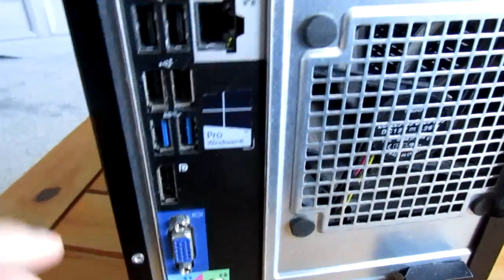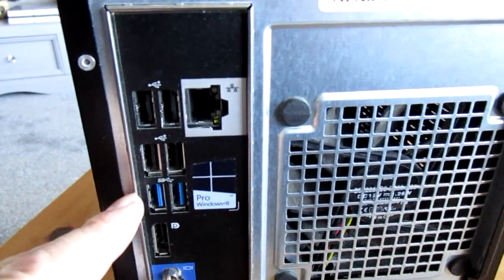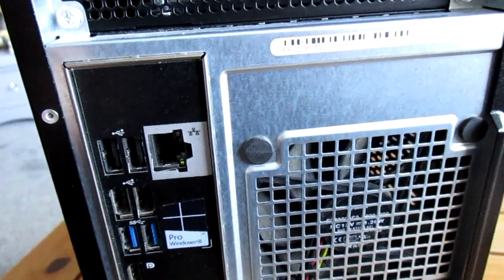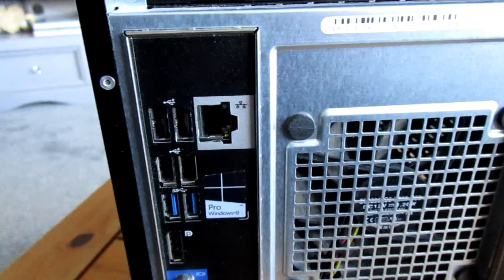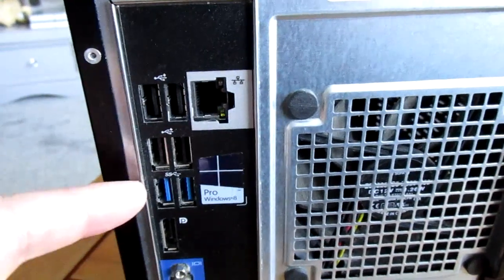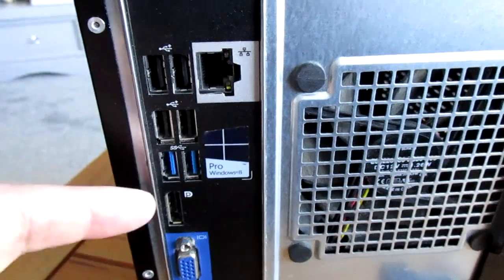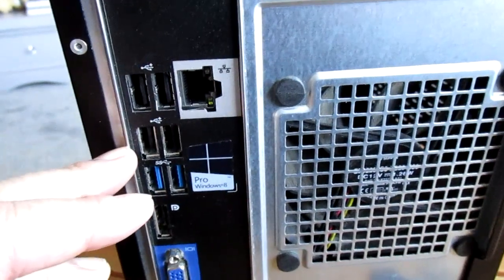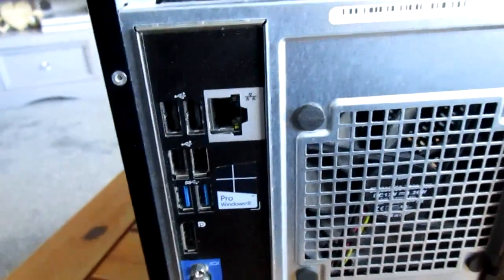Just one last thing to point out. The USB 3s are pretty important. I think you should have them on the Sandy Bridge and Ivy Bridge Optiplexes as well, especially if you're running a small solid state drive like I am, because I play my games off an external solid state hard drive, and when I've benched it that's nearly as quick as the internal one. So if you just want to buy a cheap drive to put your Windows on, that's a viable option - have an external drive for your games and plug it in, they will load and play fine. But if you plug them into the USB 2s, they're way too slow, slower than a mechanical internal.